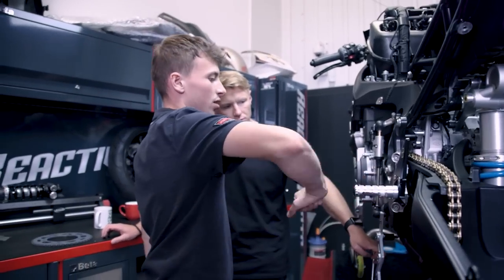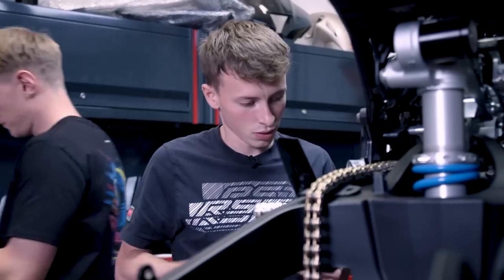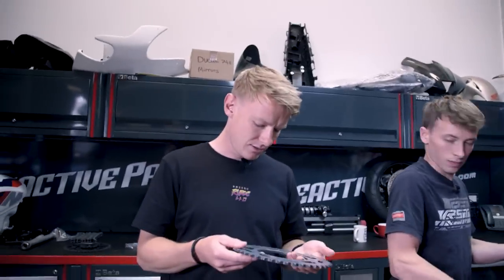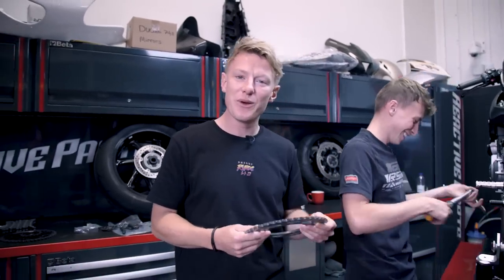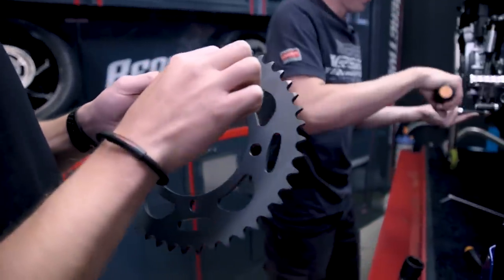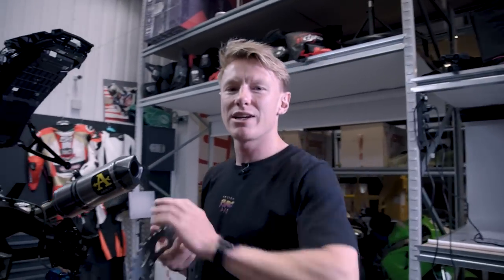Next job is the rear sprocket. We need to put the chain on first, then put the cover on, put the gear lever back on. That's the chain over the front sprocket. Now we can put the cover on — it's two little pins and then this bolt here. I always like these covers because it stops chain lube flying everywhere. Top mad dad racing tip: cover your sprocket numbers in tape so people can't see what gearing you're running — or flip it and stamp the wrong sprocket size in to confuse your rivals.